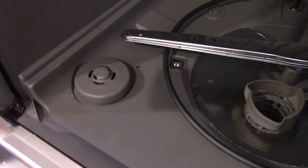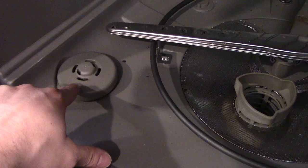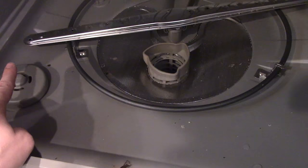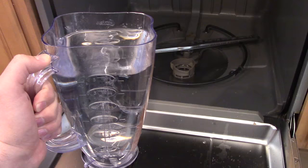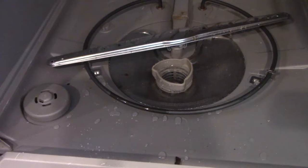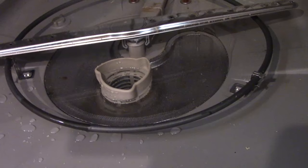The next piece of interest is this little thing right here. This is some sort of a float switch that activates the pump. Basically what happens is when this area right here is full of water, this pump switch floats up and that turns it on. So I'll pour some water in here and pull that switch up — it should turn on the pump. It sounds like there's electricity going to the impeller inside, but it doesn't sound like water is flowing.